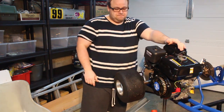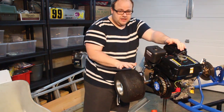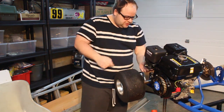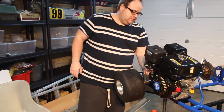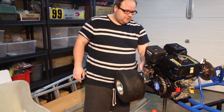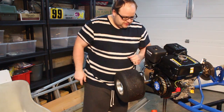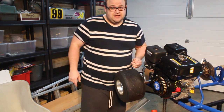What I'm going to do is use my fancy funnel with the graduated end on it — the one you saw in the last video when we were filling up and prepping the motor. I'm just going to use the drain screw on the bottom of the carburetor float bowl and drain it right into the jerry can below. That's going to essentially drain it at least to the pickup point, moving through the carb and into my jerry can. Let's try that out.